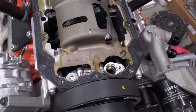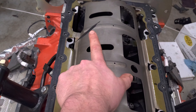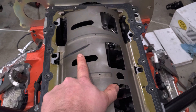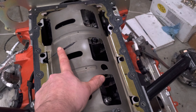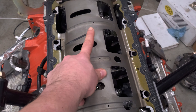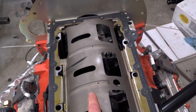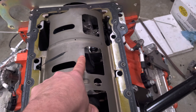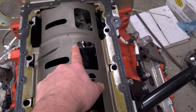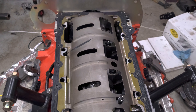Before I actually stab this on here — the pan fits, everything lines up pretty good. Mounting surfaces are already cleaned off and the dipstick fits just fine, so that ended up working out perfectly. I'll double-check to make sure the calibration is correct, but I don't see any reason why it wouldn't be. The distance from the block flange to the end of the dipstick is the same no matter what — it doesn't matter if you're using a two-quart oil pan or a 500-gallon oil pan. The whole point of the max oil level is to keep oil from reaching a level where it hits the crankshaft, and that distance from the counterweights to the block doesn't change unless you stroke the engine. So there shouldn't be any issues, but I'll double-check it nonetheless.